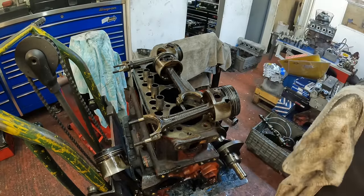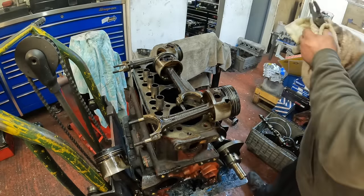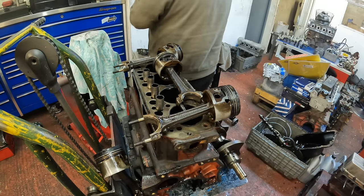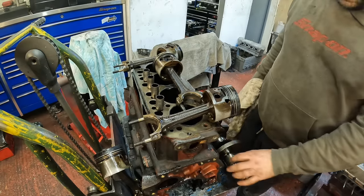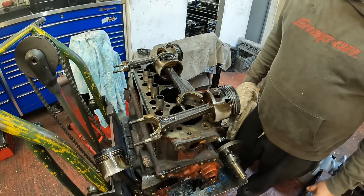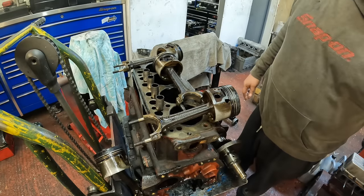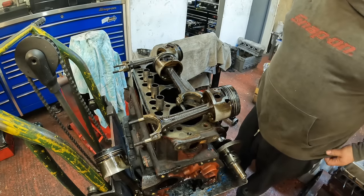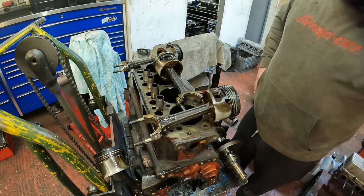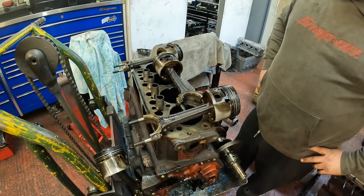So the MGB stripped down, this is the rubber bumper MGB B series engine, which, assuming the car is absolutely beautiful, the engine is the complete opposite, unfortunately. I've just quickly run through it. It's got liners fitted and I showed you the boring bar swarf. I showed you the wear on the cam and the cam buckets.